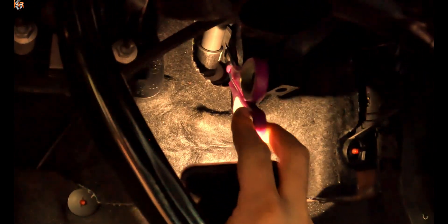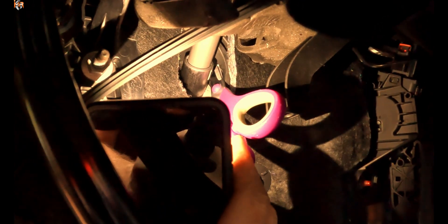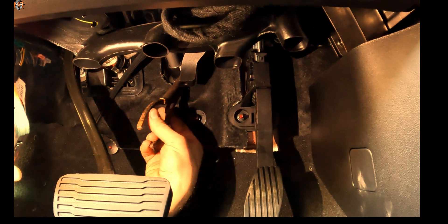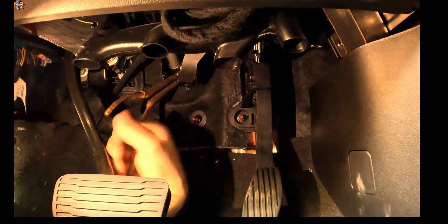Here I want to show you where I went through the firewall — this is the steering column, and I went to the side of it and put the scissors through. I'm going to put some needle nose pliers through here so I can grab the plug from the engine bay and feed it into the cab. I went ahead and put my needle nose pliers into the slit opening of the boot, and I'm going to spread them so somebody on the other end can feed me the plug and I can pull it through.